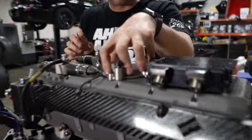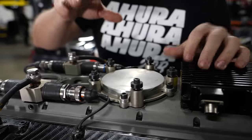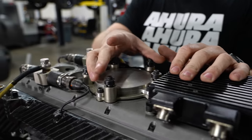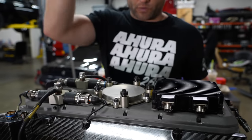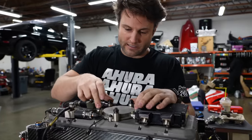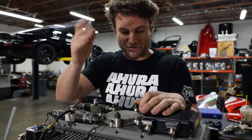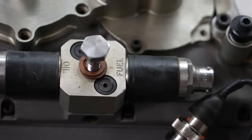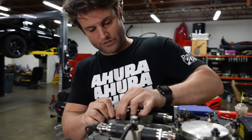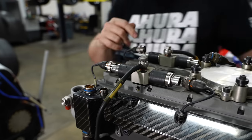This was called a pop-off valve. The pop-off valve was the only way they really regulated this motor team to team. It's basically your blow-off valve, and it makes sense that it was way up here away from the exhaust — shooting what could have potentially had methanol inside of it from the pre-turbo side up into the atmosphere away from the motor. This was something you did not want to fire off, and so they had sensors to watch when it was getting close to opening. These four things up here are oil, fuel, boost, and water pressure sensors only — there are tons of wires, but that's not indicative of what they do. They are just pressure sensors and I have the wiring for that.